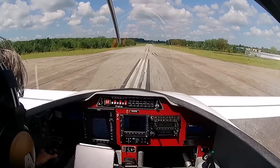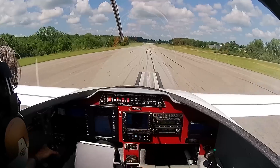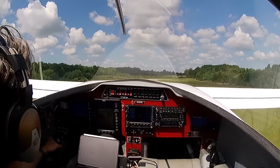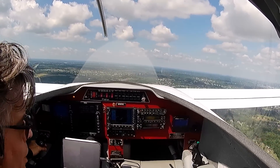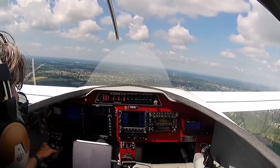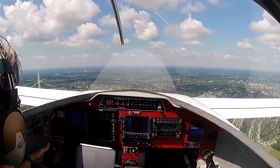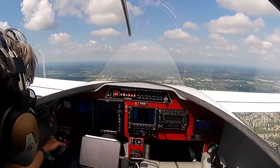Airspeed alive — 40, 50, 60 — and up we go. Gear up. Now I'm going to shut off the manifold. We drop down to 40 degrees. Let's see if the CHTs come down. Yes, they do. So the EIS definitely needs some adjusting. Now my CHTs with full power are down where they should be with the manifold sensor shut off.